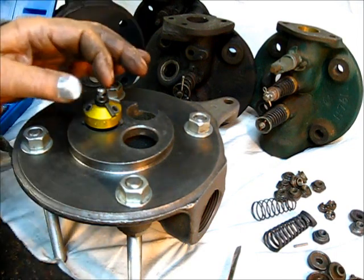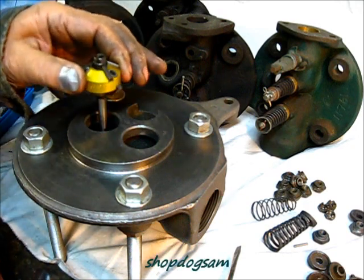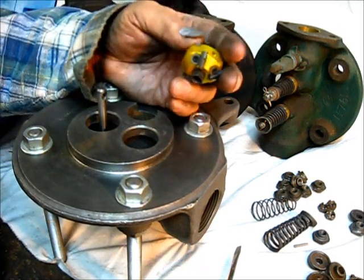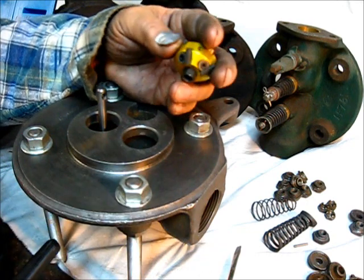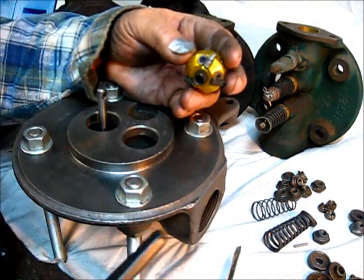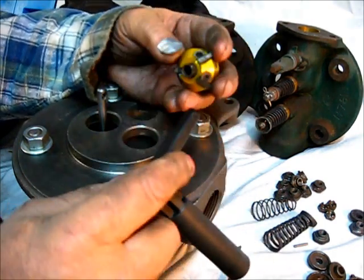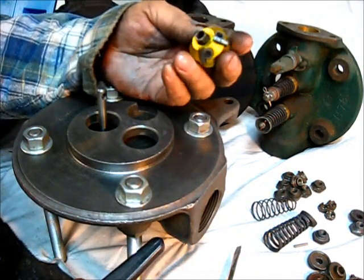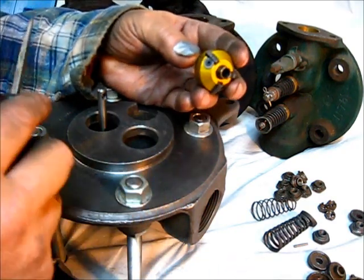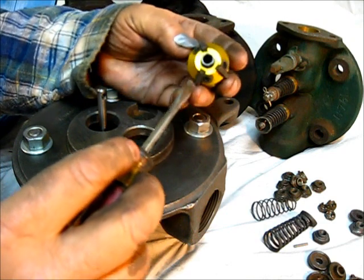There is a handle, and there is also a motorized apparatus available for these cutters. One thing to emphasize: do not turn this cutter in reverse. It's a carbide cutter — they are very delicate. Harder than a rock, but they're easy to chip — kind of like glass. I've cut many a valve seat with this set right here; they do last a long time. The ideal position is to get your valve seat in the center of the cutter blades.